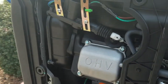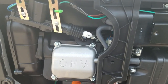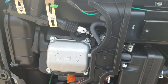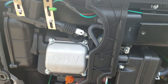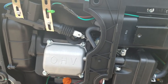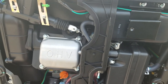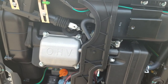Some of y'all are saying that once it gets hot, usually the engine won't start back on choke — it has to start on run. Well, not in this situation, because it happens so fast. When the actuator pulls the choke, as soon as I let off the starter it actually opens back up. So it allows the engine to start even when hot. It starts cold with choke, and starts hot when it's hot — it just runs.